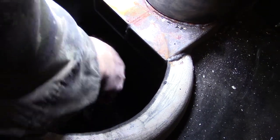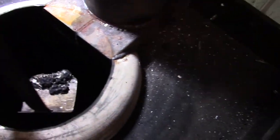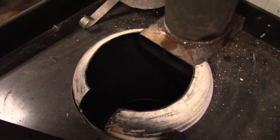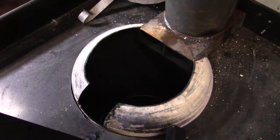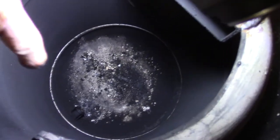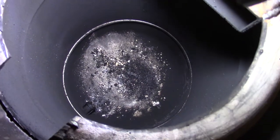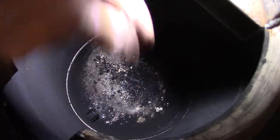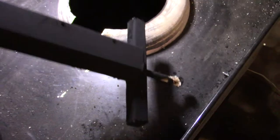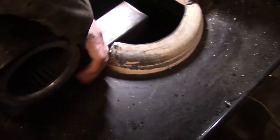You don't have to do this every time, but I do. Down in here is where the oil comes out — down yonder, that little pipe that comes in. It's as simple as that. The oil splashes out of that or just runs out into the bottom of this chamber. We're going to put our blower assembly back in — it just snaps into place like that. That's how I built it.